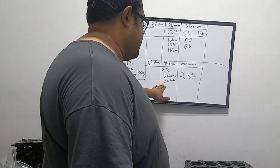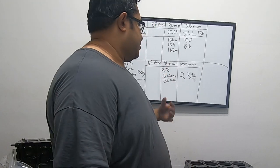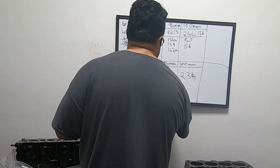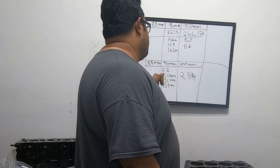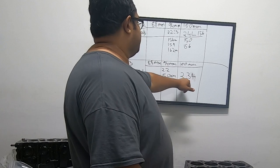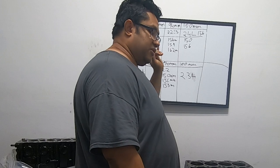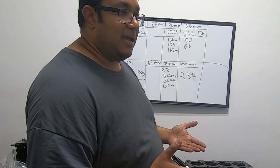The best approach is to call CP Pistons, tell them you're using a 156mm rod and the wrist pin needs to be moved up 9mm, and they'll tell you which part to get. English Racing actually has an aluminum rod at 153mm — they call it a 'short long rod.' With that rod you'd move the wrist pins up 6mm, which are the same as the 2.3 stroker size offset pistons. You can use those on the 4G63 with a 153mm rod and get your 2.2 displacement while still revving to 9,000–9,500 RPM.